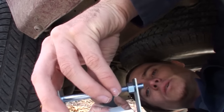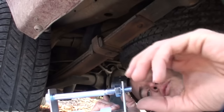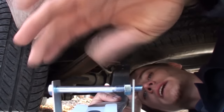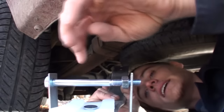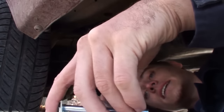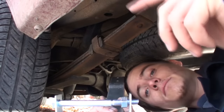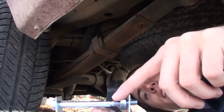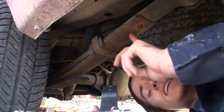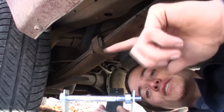The bolt that holds on the rear part of this spring comes with two nuts. One of the nuts goes on the inside of this bracket and one goes on the outside. If you didn't have this one on the inside, it would just crush these brackets in. So I've adjusted the nut ahead of time to where there's a little bit of a gap, so it does squeeze it in slightly, and that'll sort of act as a lock washer. If it comes a little loose, I'm going to end up putting a lock washer in there and maybe some Loctite. But once you've tightened up the U-bolts on the front, this back side is pressing up against the spring anyway, so even if this came out, it wouldn't spell disaster — but if you've got it, you might as well just use it.